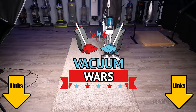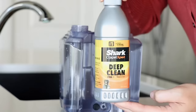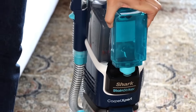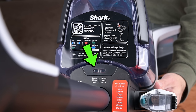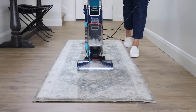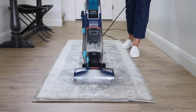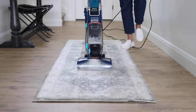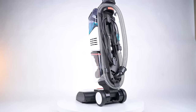So links in the description, and let's get started. First, the basics. The Shark Expert operates by first filling its clean water tank with warm water and the included solution. You also fill up its separate oxy tank with Shark's oxy solution. You turn it on and pick either the deep clean mode or the express mode, which uses less water and dries faster. Then you simply vacuum back and forth like you would a regular vacuum to clean the carpet. The machine automatically mixes the solution and dispenses the water, so there's no need for a trigger to manually dispense the water. It also has a built-in hose and attachment set for spot cleaning, but we'll talk more about that later.